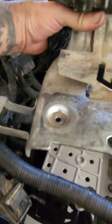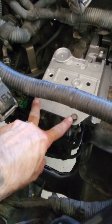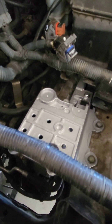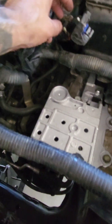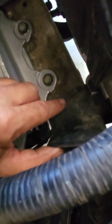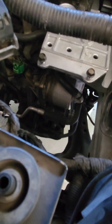I just kept the whole bracket — that's going to be two 10mm bolts here. Just be gentle with it. These are going to have two 13mm bolts here; this piece comes off. Just put this one out of the way. I marked all these one, two, three. Pretty much after that, use a screwdriver to press on the tabs and the whole tray will pop out. Then you can pull everything out and you've got access to the transmission cooler.